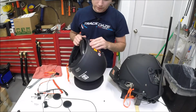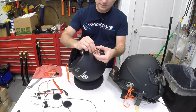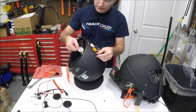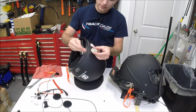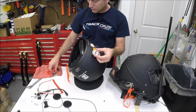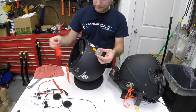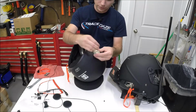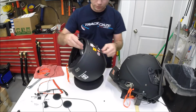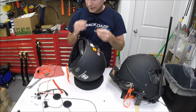But if you're using an older helmet such as this SA 2010, you need to make sure you order the Hans anchor kit that includes these large washers. This will go on the inside of the helmet and is what the bolt will thread into, that will anchor the device to the helmet. And it helps disperse the load, right? You wouldn't tap threads into the helmet. They would just pull right out. So just make sure if you have an older helmet that you're ordering the right kit.